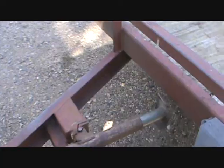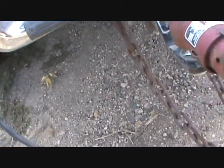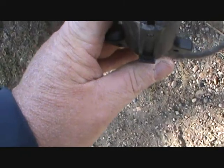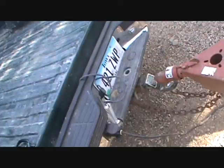I've had this trailer since 2001. And you know, some trucks I hook up to, it works no problem. My trucks, it seemed like I'd have to ride around until that ball would rub or something. So today, for the first time since owning this thing since 2001, I took this plug apart to see what's going on. And if I wanted to, I can now wire my trailers for work lights, because with this truck I have a 12 volt power supply and it's working. And I know which terminal to hook up to now.